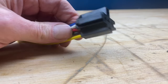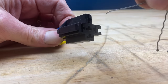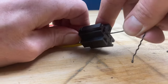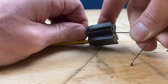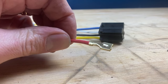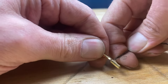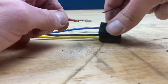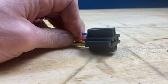Let's do one more just for fun — how about the middle one? That one is red. So what we'll do is we'll take the hair clip facing downward, slide it in the little notch here, push down and hopefully it will slide right out. There we go — we've popped it out. You can see the little tab sticking up. We might have to bend that up just a hair to get it to stick in the connector again. But then we can just slide it right back in. Boom — now it's locked back in place.